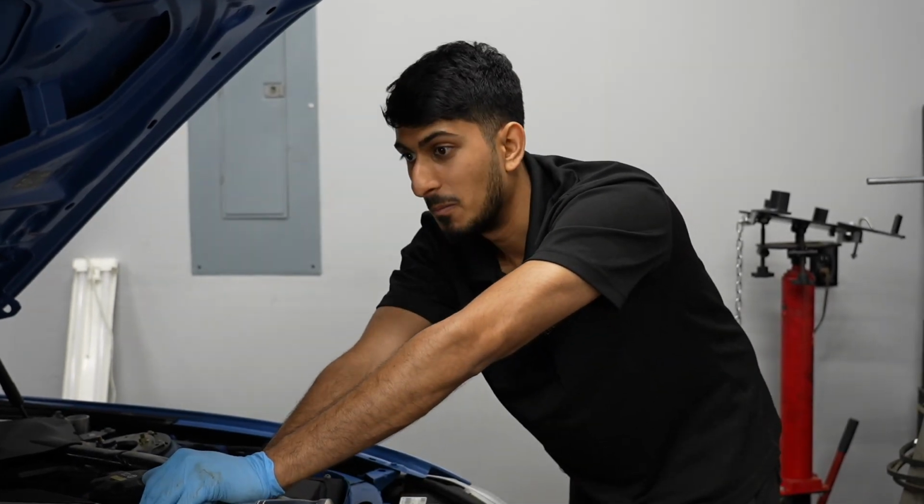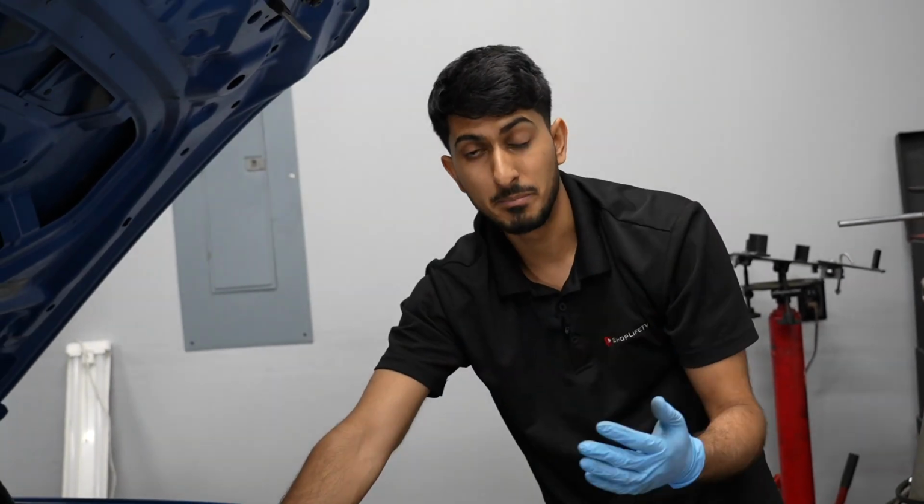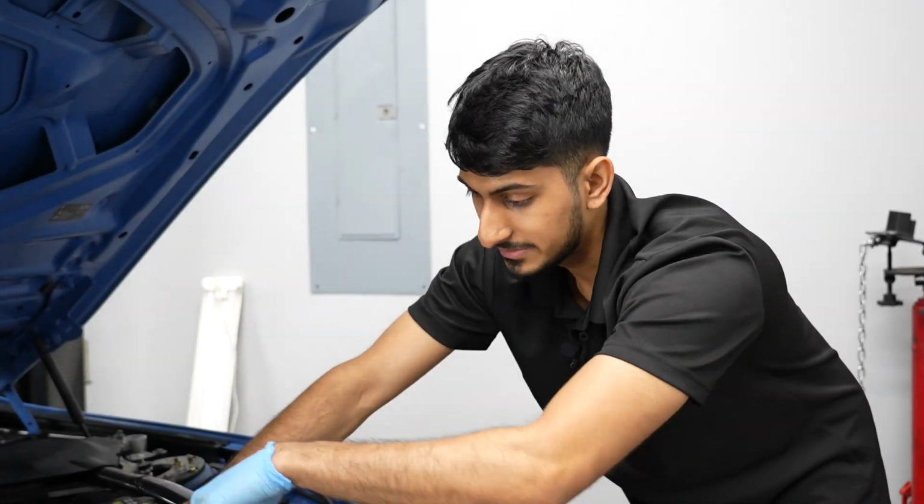They are plagued with one very, very bad issue that can pretty much kaput the motor, and that is the crank hub. So, this is a turbo engine. With turbos, we can up the power just with a simple tune. The main reason we haven't done any kind of tuning on this is because I'm kind of scared of that crank hub, and I definitely want to take care of that first before we do any tunes or up the power. That DIY is going to be something else, because it's a procedure. But that definitely has to be done before we turn anything up on here.